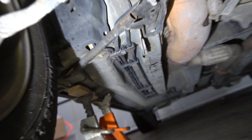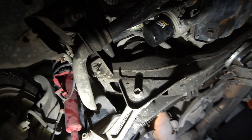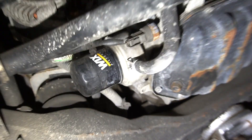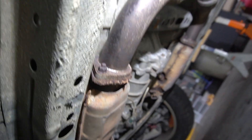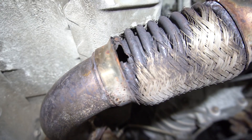Finally got to take a good look underneath. This thing is in pretty good shape — not a lot of rust at all, it's pretty crazy. Thank you Nissan. Look at this oil filter placement — got the oil filter here and the drain plug right there, can't get much easier than that. Coming around to the side here, I think that is the source of our leak right there. That's the Y-pipe as suspected. Confirmed leak.